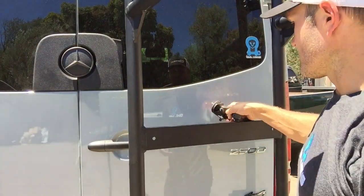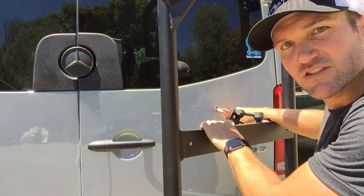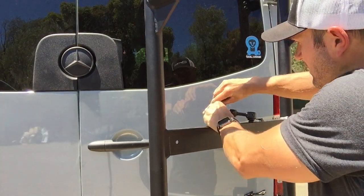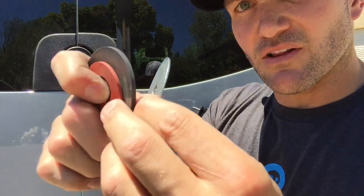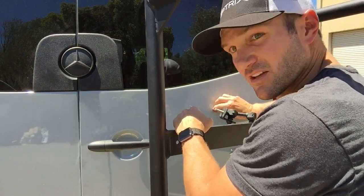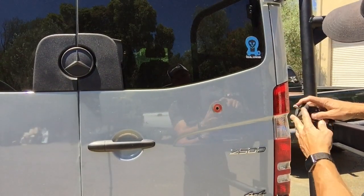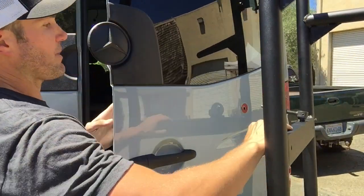The last thing you need to do with the install is mount this sway link through the door. When you took out your door panel, removing this magnetic puck should be super easy — I think it's a 13 millimeter. You just take that 13mm off the magnetic puck. On the sway link you've got three washers: one that goes against the sway link, a large black washer, and then a smaller red silicone washer. That red silicone washer fits nicely in that little space. The metal one and the black neoprene one go against your door. Then we're going to feed this through that hole — we've already got our backing plate in there from earlier.